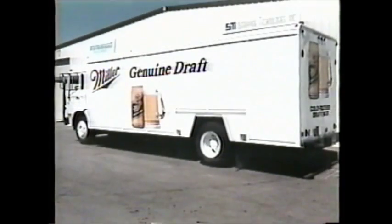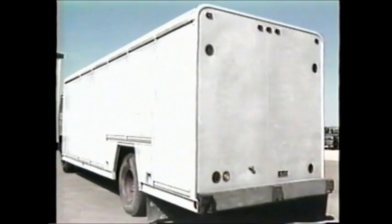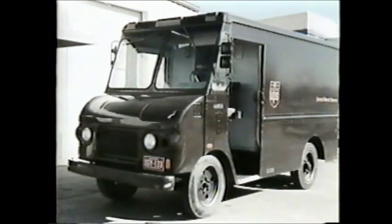Plastic media stripping works well on automobiles, but it also works well on larger heavy-duty vehicles. For instance, this 12-bay beverage delivery truck was completely stripped — including cab, aluminum box, and wheels — in just six hours. More and more vehicles are incorporating fiberglass in their structures. This UPS delivery van's fiberglass nose section needed repainting, and the PMB process was the solution.